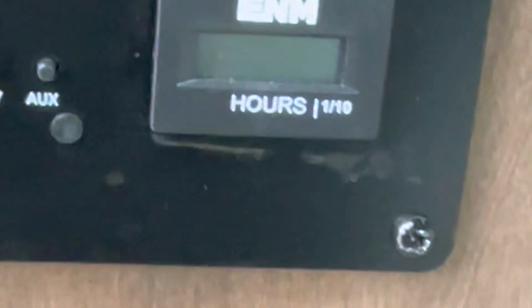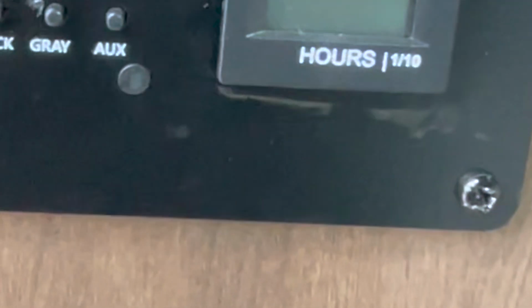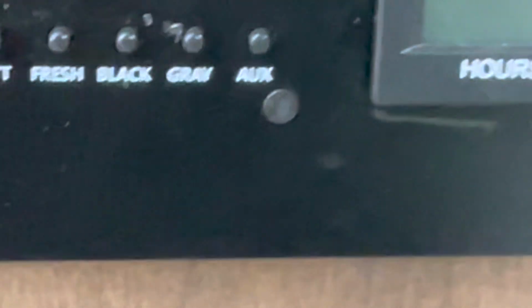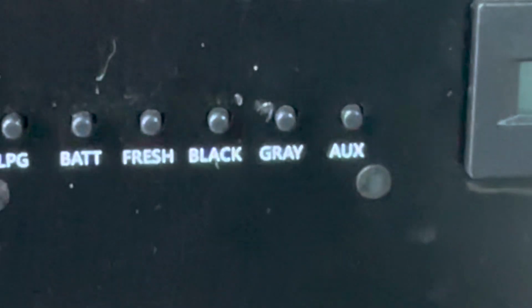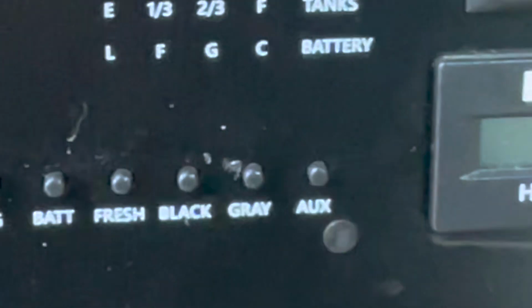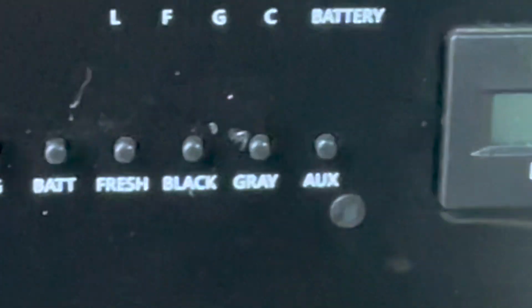Okay, here's the other water pump I was talking about. Turn this on, it runs the power pump. You'll hear it. Turn it off because we don't need it. Gas water heater. This gas DSI fault will turn on until the pilot light has fired up. So if after about, let's say, 5 seconds, this hasn't gone off, turn this off again, because it means that the gas is not lighting up.